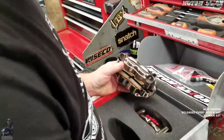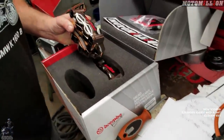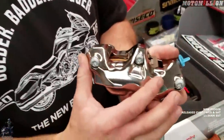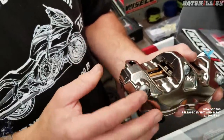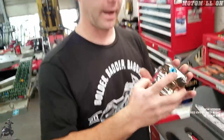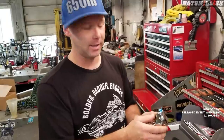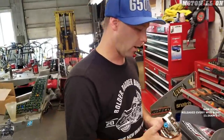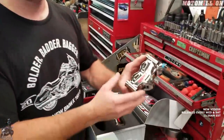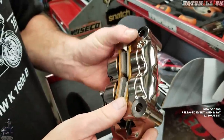So the cast ones are stock. Then if you look at the HP4 it has cast ones still but they're monoblock — machined as one piece, so there are no bolts holding two halves together. That makes it harder to twist. With a two-piece caliper there's still a point where it could move or distort under heat and forces. These billet units we're installing are an upgrade because they're CNC billet and then nickel-plated, and that nickel actually helps with the precision of the CNC machining as well.